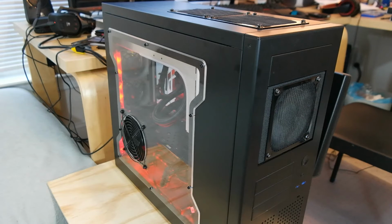Now, with the side panel fan put in with custom fan curves, I'm not exceeding 73 degrees Celsius on the GPU, which is a lot better. That looks like what everyone else is getting when they use R9 390s online. I'm seeing a lot of 73 degrees Celsius max temperatures when people are using high-performance video games and benchmarks. So 73 degrees Celsius for a GPU from AMD seems more reasonable to me. So I think that this is an improvement.